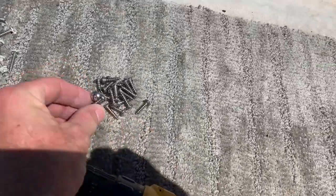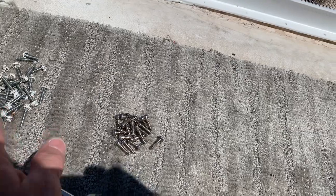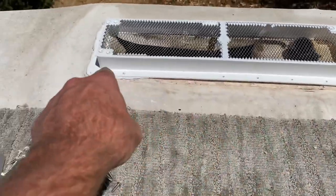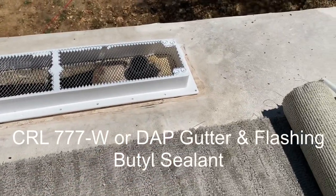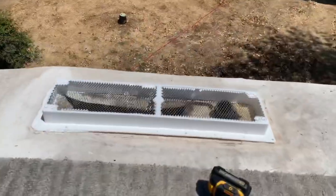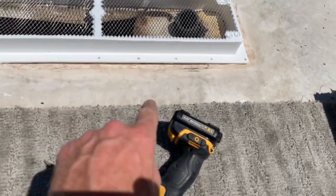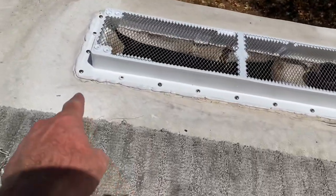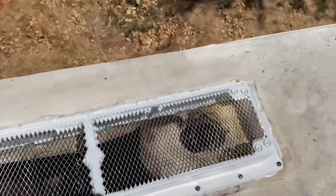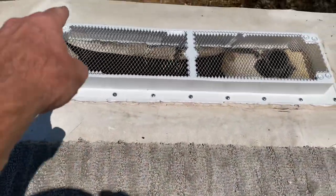I've got my new stainless steel screws — these are Phillips head screws. I like to use these instead of the quarter-inch hex. I've already got my bead of sealant all the way around and I'm going to start running my screws in, then I'll go over the top with the self-leveling Dicor. One quick tip: start in the center on both sides, that way you're not bubbling up in the center. Once we have all our screws in, you can see sealant squeezing out all the way around.